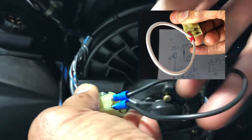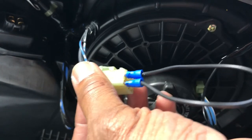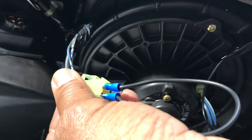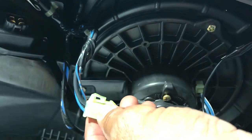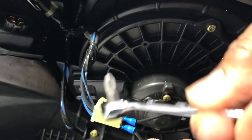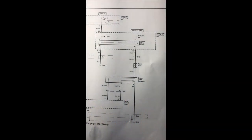Okay, there's our blower motor — it's blowing. So at this point it looks like what it normally is in these cases: it's the blower motor transistor. We're going to take another look at the schematic, go through what we just did, and then take that blower transistor out. On this 2004 model, one of the screws on the right side is fairly hard to get out — you'll need an offset screwdriver since you can't get in there with a straight screwdriver.